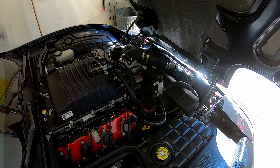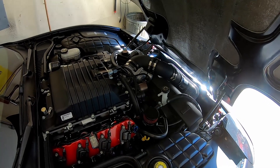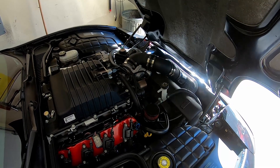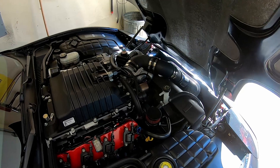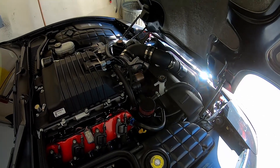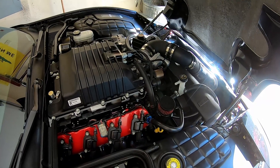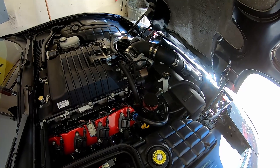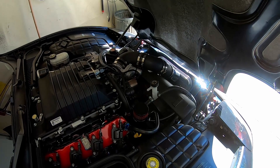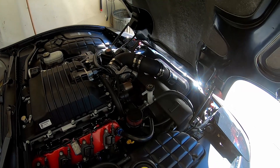I made no changes to the tune. All I did was a couple of different key cycles, had to get some fuel and drop a package off at the post office, and out of nowhere the idle started working just fine, the rolling idle started working just fine, and the trims were back pretty much where they belong. The trims could be off just a little bit since there is a difference in the throttle body — the throat is different and the blade operates differently — so it might not be a bad idea to do a little VE table tuning to make sure it's good and efficient. It was just odd that it had those anomalies early in the test drive, then after two or three key cycles it started behaving itself.